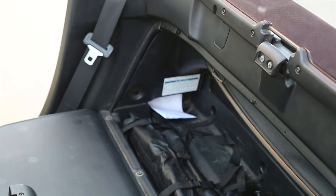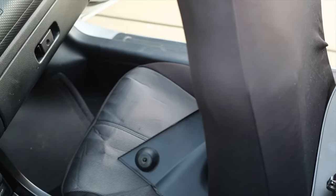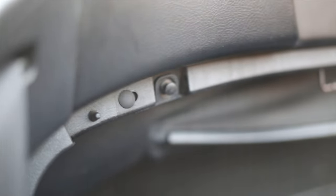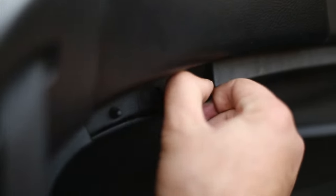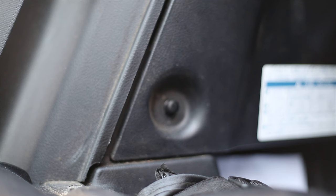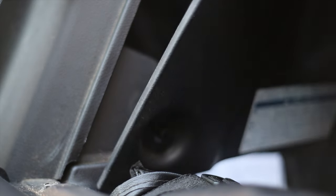You don't have to open the back compartments — we just have to take off the little side panels. When they are removed, they'll look a bit like that. It's a bit confusing to put back in, but it's manageable — just keep the stickers facing upwards. The first clip is right up here by the top and just pops out. The second one is right down here by the door and also just pops right out, and out comes the panel.